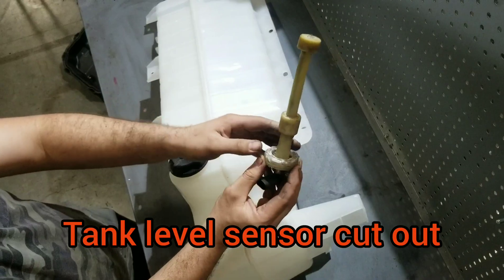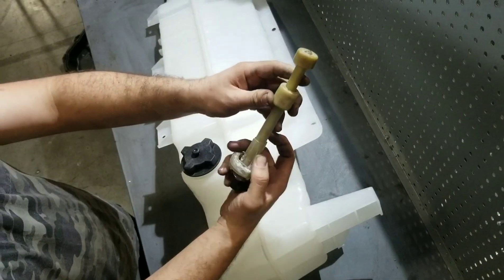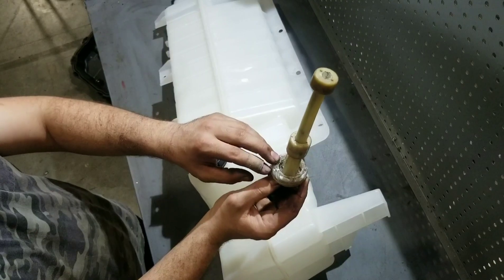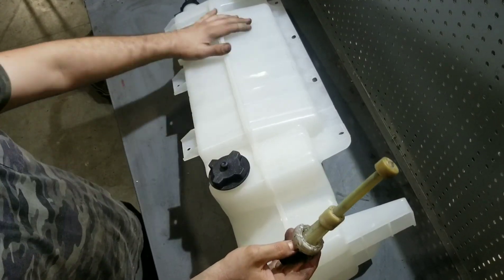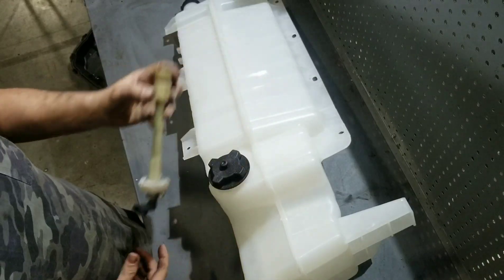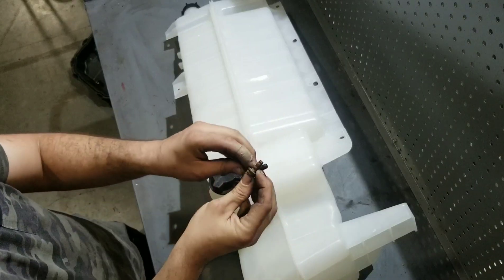I did a cutout — this is actually one of my tools. If you have an old expansion tank or old truck, you get a bunch of garbage inside the tank and it gets stuck. So when you drain your coolant and refill it again, if it still shows coolant is low but the tank is full, your float is most likely stuck down. You need to grab a rubber hammer and hit it right about this area to create a vibration so it comes back up. If it doesn't come up, then you'd replace the tank.